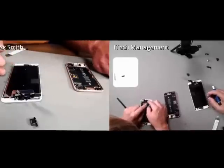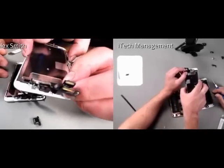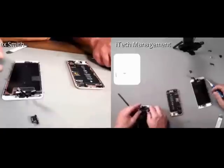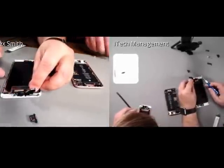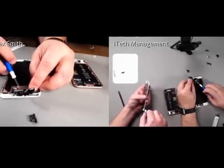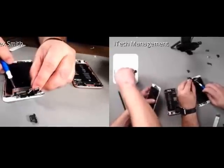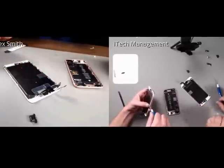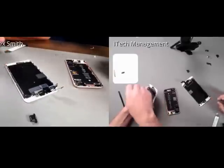But I'm going to just peel it back, and then I can lift out. Is this a 5 megapixel front-facing camera, Ed? Yes. So 5 megapixel front-facing camera, very similar to the, 1.2 megapixel last one? Yeah. And so the ear speaker bracket also counts as a thermal plate here for the 3D Force Touch engine controller, which is kind of interesting. So it acts as a force plate? A thermal plate. Thermal plate.